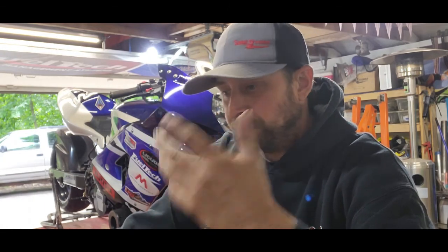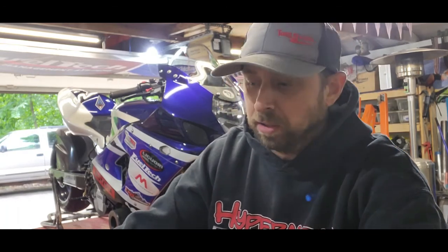Now it's time. It had pump gas in it, and that's how it's been sitting. I don't know how long, but I wrecked the motor in the Dodge at the beginning of March, so probably I had the bike running January, February at some point was the last time it was actually fired up and running on pump gas. I just don't want to leave it with the methanol sitting if I'm not going to run it a lot. You can leave methanol sitting in the bike if you fire it up once in a while, or if you're racing frequently. It's fine for a couple weeks here and there, no big deal.